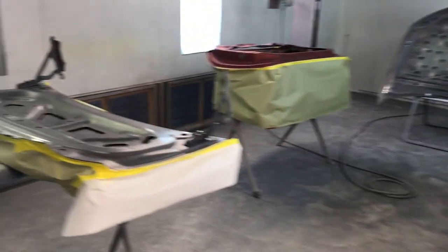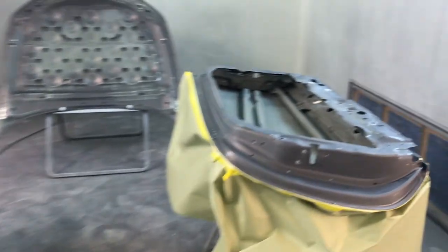We got all these parts set up in here — everything's taped up and everything's been scuffed, so we can start painting. We have a couple of choices when it comes to sealer on these parts. I can use regular 2K sealer because there's not a lot of bare metal, or I can use the epoxy sealer wet-on-wet like I'm going to use on the car, because the car has a lot of bare metal with the roll cage and I like the epoxy for bare metal due to its good adhesion properties. We'll probably just lean towards the regular 2K sealer since I don't see the advantage of using epoxy on these parts.